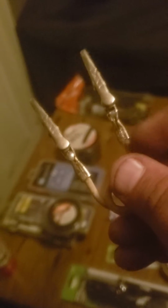And I just cut a length, wrapped it around one loop around a mandrel, and then stripped the insulation off and soldered these alligator clips on. And what it does is I can put both ends of the wire, with the area I'm soldering, right here, and it holds them in place while I'm able to use my other hand to hold the solder. I'll show you how to use that too.